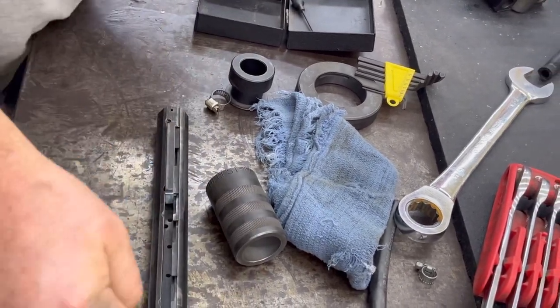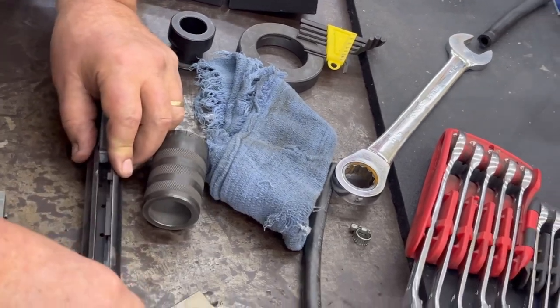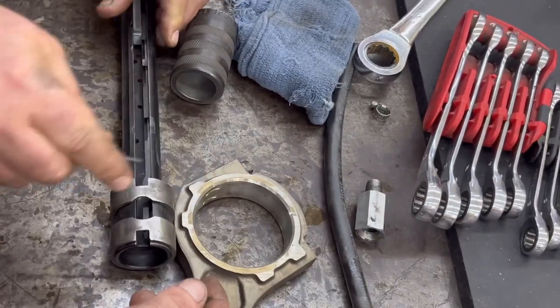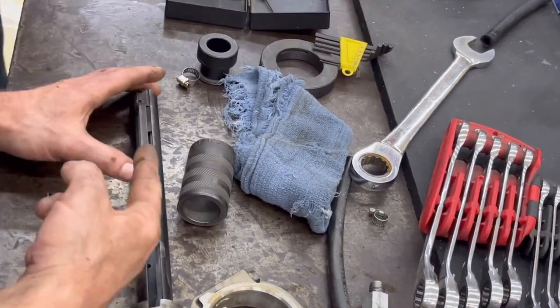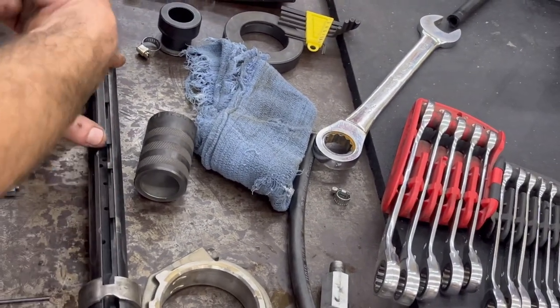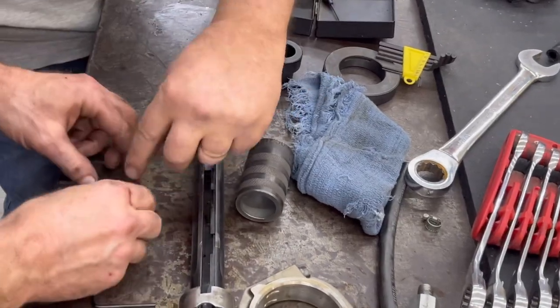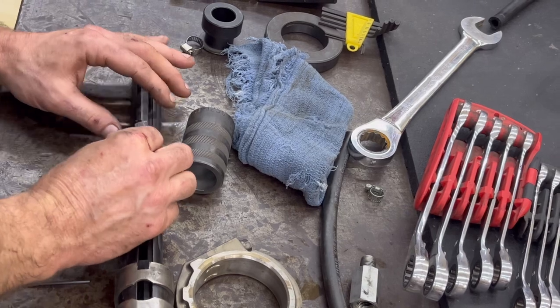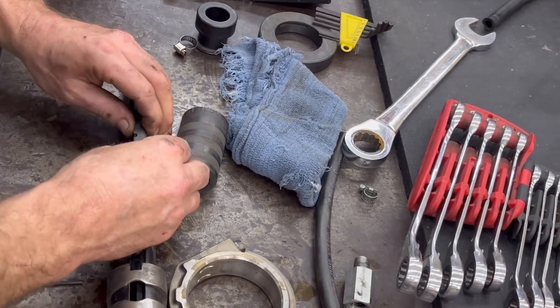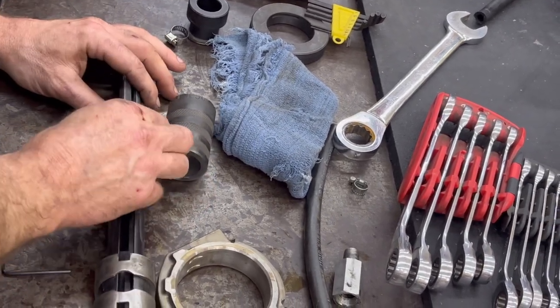See, your wedge is all the way in. This is the wedge that travels. It makes that stone go up and down. So now you can put your tension. I need the wedge pulled back and the stone pushed forward until you can get everything together. Now you got to put that in. Just line it up, and then you run your set screw once you're bottomed out, everything lined up. And you got to snap it in with a little bit of effort.